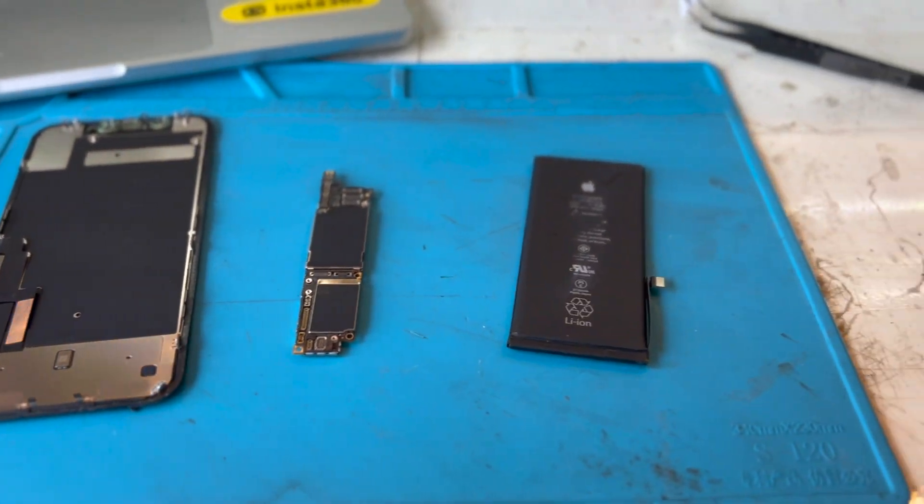I have also seen on more than one occasion the battery swelling and needing to be replaced from either glass shards puncturing or accidentally from a razor blade slipping during the glass removal process. The nature of using a razor blade to clean up broken glass around very sensitive components like flex cables, logic boards, and batteries means the possibility of damaging one of those during the process is higher than if those components were removed and out of the way. This leads me to my next option: the same glass back repair, but removing all of the sensitive components to mitigate risk. This is the only way I will perform this type of repair, and there's nothing inherently wrong with the glass-only option as long as it's performed the safer way by a skilled technician using quality parts and a strong commitment to quality workmanship.